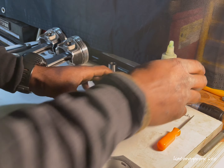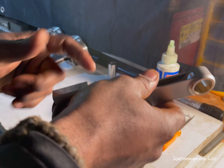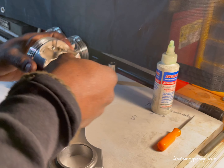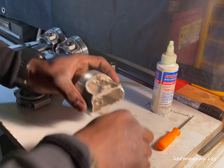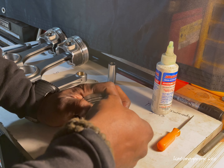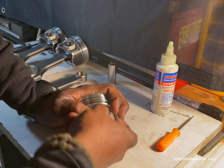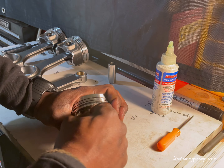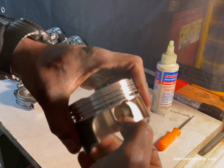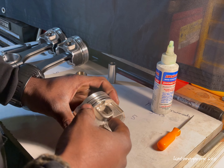Check the location of the relief valves and the location of the notches on the connecting rod. Slide in the first wrist pin — this is just how I do it, a lot of people do it differently, so to each his own. Use your middle finger to guide it in on the bottom. These notches are also for when you want to pull the engine apart — you can use them to disassemble.